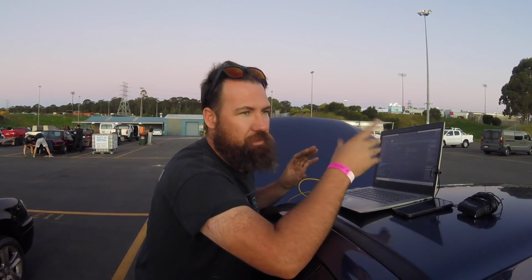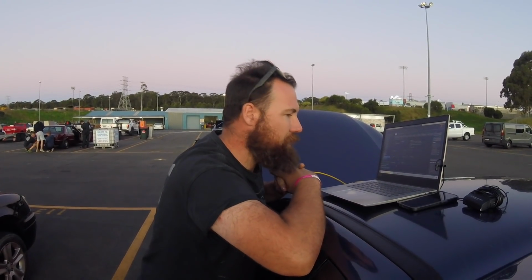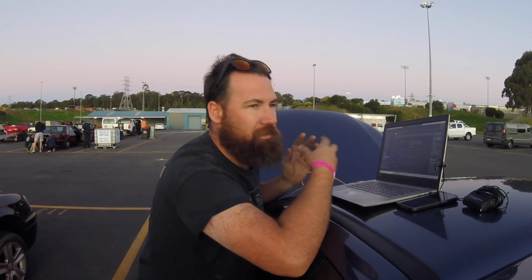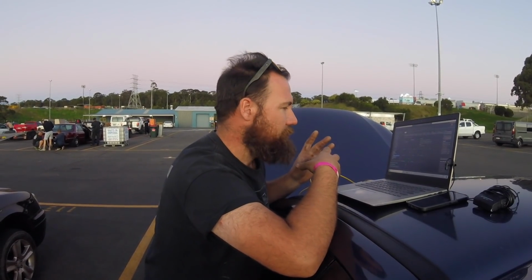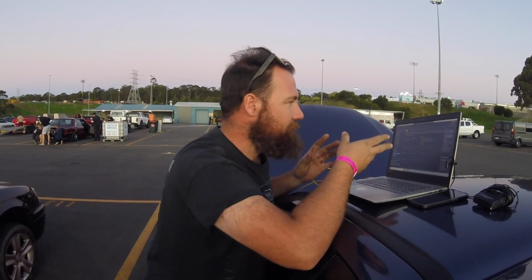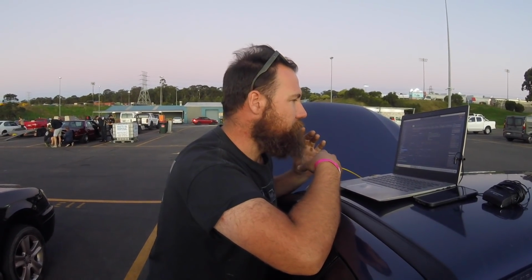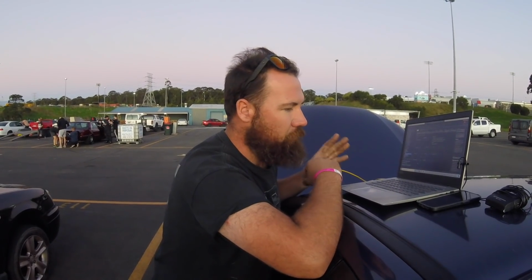It's along a similar line to how Scotty made two boost maps based on cruise control. That was also with generic tables and setups from memory. So it's pretty cool to be able to make the most of factory settings and factory switches, even with things like the Elite Pro plug and play. Adding the NSP firmware upgrade to an existing ECU just totally transforms it. So we've basically opened up even more functionality than what the ECU had in an ESP or an Elite format.